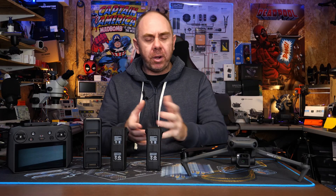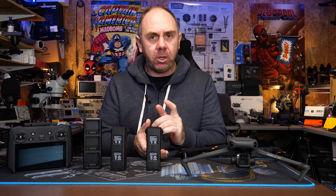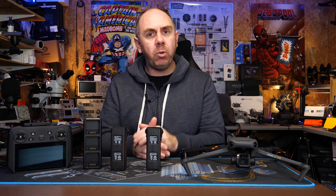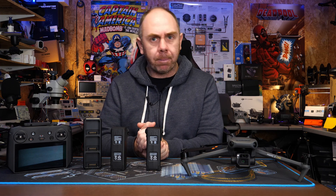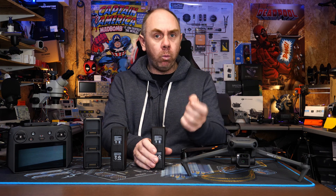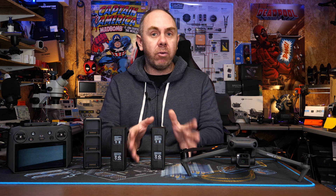With regards to self-discharge, as I've said the feature is built in but I don't recommend relying on it — I would always try to manage the batteries yourself to get the best possible life. Storing them should always be at roughly room temperature, at about 60–65% capacity, or just as the third LED is flashing on the back of the battery. I also don't recommend leaving them the maximum 12 days — manage that self-discharge yourself, and you will reduce any risk of swelling like we've seen on previous models.